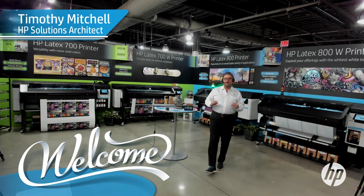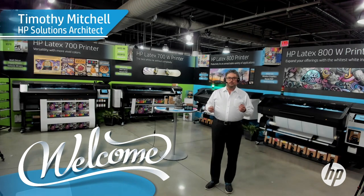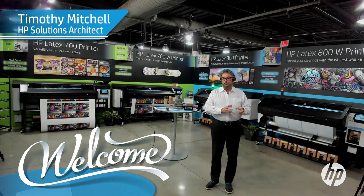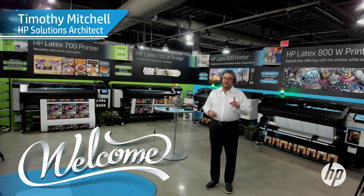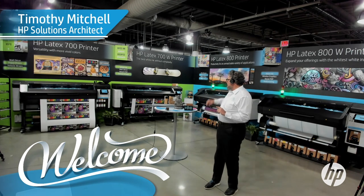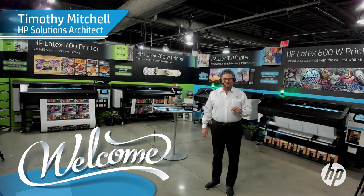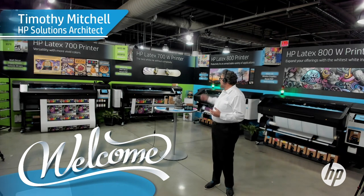Now, technically, you cannot hot swap ink with a 700. You can, however, place it in when it runs out. I use the PrintOS feature of PrintBeat, which manages my printers. It sends me a notice. Like, I know I am very close to running out of ink on Paul over there on the 700W. I have 1% yellow left, and it could run out when I do a print here in a second. So that's why I have the yellow on top.